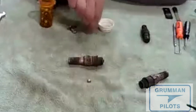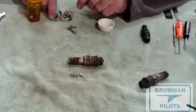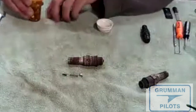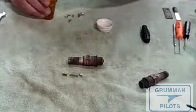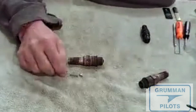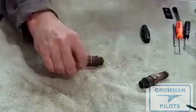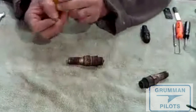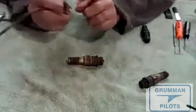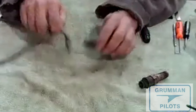Inside Champions you'll see a spring and a resistor. Champions have had some quality control issues in the past, so I switched over in the shop two years ago to Tempest. On a good plug with worn electrodes, we can harvest a good resistor and save a plug that has good electrodes but a bad resistor. If resistance is over 5,000 ohms — and we've pulled plugs at 30,000 ohms or even one megohm — they arc on the lead inside the barrel or, worst case, arc back inside the magneto, trashing the mag.